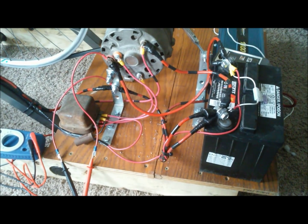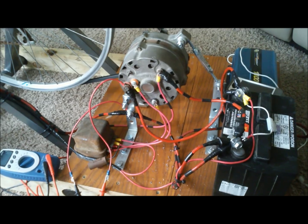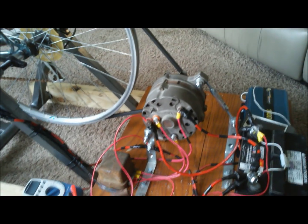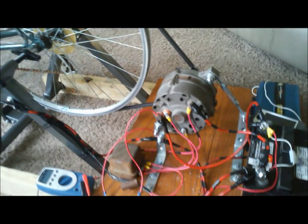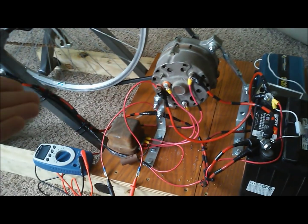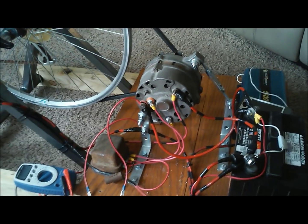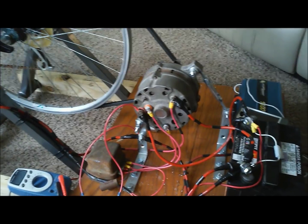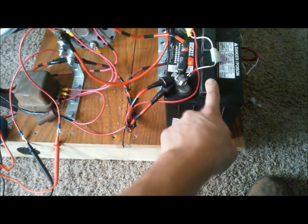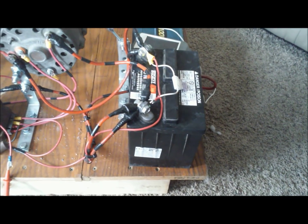Overall the system was pretty simple to put together. If you have any wiring questions about what alternator you plan to use, just shoot me a message about what it came out of — modern alternators are pretty simple and I can direct you. Now, alternators are kind of interesting: they're not like a generator — they take power to make power. Without a power supply, it's just a bunch of coiled wires spinning around. Once the system has power sent to it and it's magnetized, then it can make power. That's what's nice about having a battery in the system — if you didn't have this, you'd have to have a 12-volt battery pack anyway.